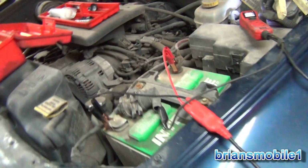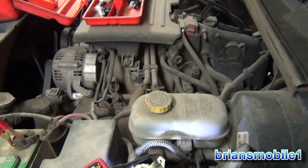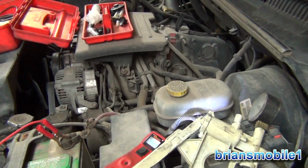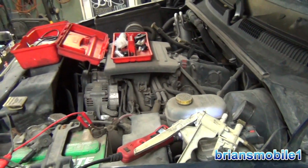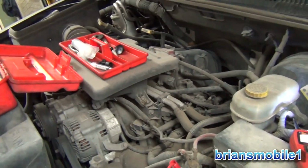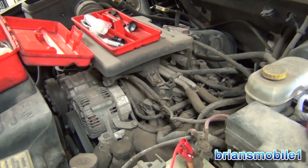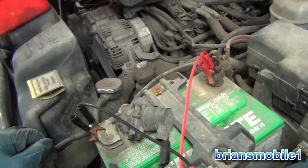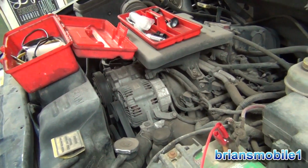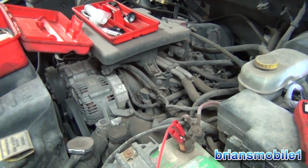You've got program fuel injection on everything on startup. You go to start the engine, and it just basically kicks up and runs on a program that's a little too rich or whatever. It's why it smells funny when you first start a car. And you warm it up, and your catalytic converter gets warm, your oxygen sensors' heater circuits work, and they warm up and get your car running efficiently with feedback from the mass airflow sensor, MAP sensors and everything. But otherwise it just starts based on, you know, this ought to do. It just gets the vehicle going.